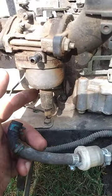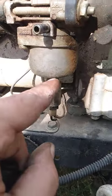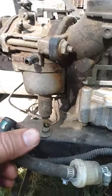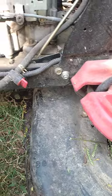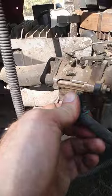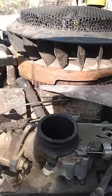Just don't get anything dirty — set stuff aside and inspect it. Mine was real dirty. Right at the bottom there's a little rubber springy thing, and it was being prevented from letting the fuel through. I cleaned that all off — here's the gunk I pulled out. Just used some starter fluid, sprayed and dumped, and worked the springy part until it was working freely. Now we're getting fuel good and some fire out of the air intake.